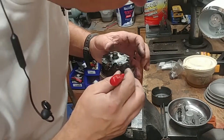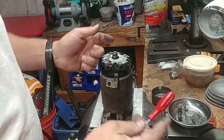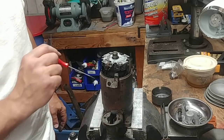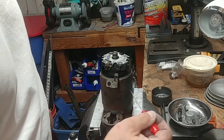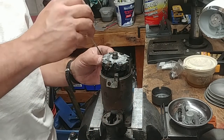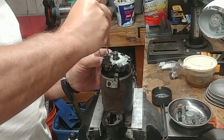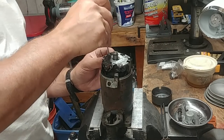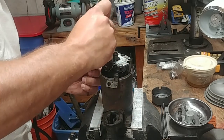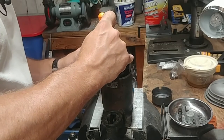What I'm going to do is take two brushes out - the ones that are connected to the stator windings. The stator windings can be removed by removing four bolts, but often those bolts are so stuck in there they don't want to come loose, so I will not even attempt to do that. I'm just going to use the trick of pulling the two brushes off that are connected to it and then just leave it alone.